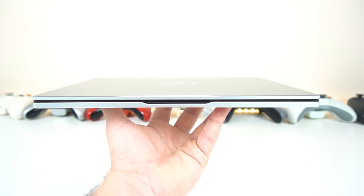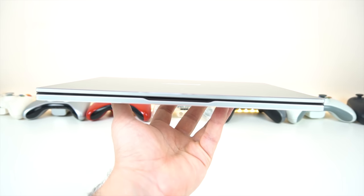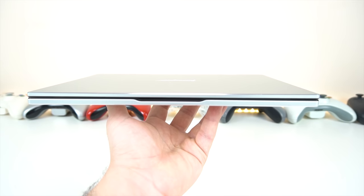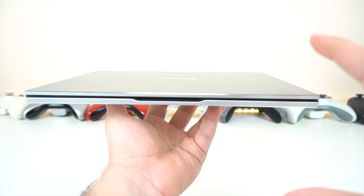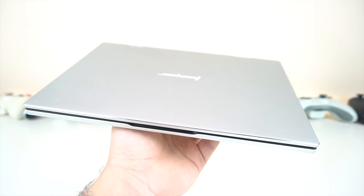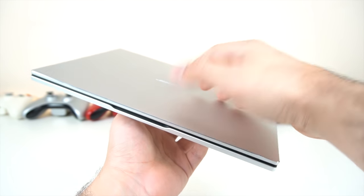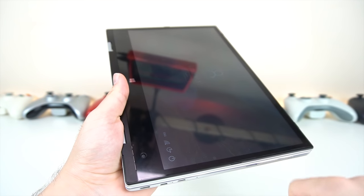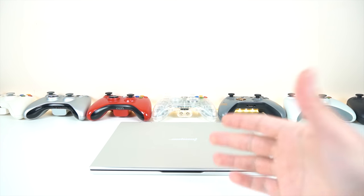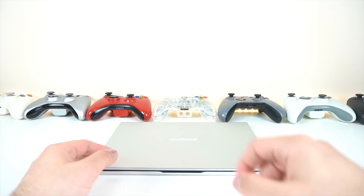The conclusion: should you get this thing? Unfortunately, definitely not. This thing is full of issues. When you reinstall Windows, the keyboard, touchpad, and touchscreen stop working after sleep — when you close the lid and open it back up, those things stop working. Everything else works; if you plug in an external mouse or keyboard it will work, but the built-in controls stop completely. Additionally, in 360 tablet mode, the keyboard and touchpad disabling feature doesn't work, so you'll accidentally be pressing the keyboard and touchpad from the back. If you want to try your luck with it, make sure you don't reinstall Windows or make a backup of the drivers. I would love to recommend this, but it's full of issues. It could just be my unit, but that's all for this video.